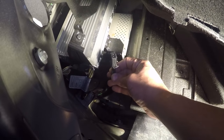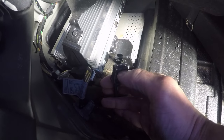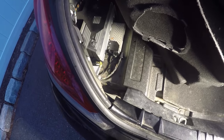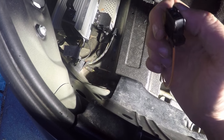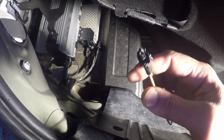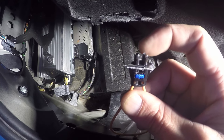In the back you're going to have a fiber optic connector going to your satellite radio. Unplug that — you'll see it's a male connector, which is why we need the female fiber optic bypass. Inside you're going to see two fiber connections; you're basically going to make a loop with that adapter. When you get your female adapter, it won't fit over this male connector, so you'll have to completely remove the perimeter of the plastic plug. Peel all that plastic away with pliers until you just have those two prongs.